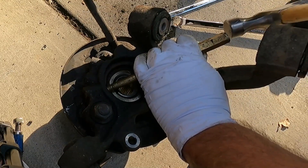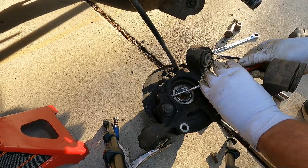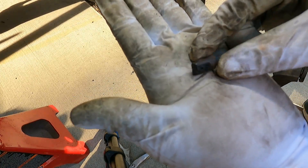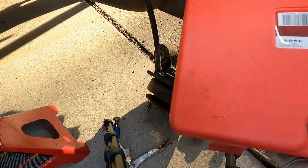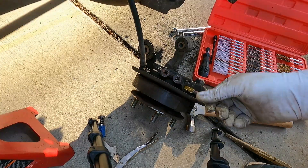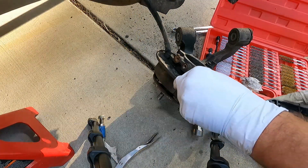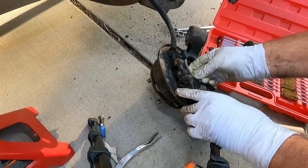I'm just wondering if I can tap it. I went and found this screwdriver that is already bent and it looks like it's going to work perfect — let's see if we can get that the rest of the way out. Got it — that's the rest of the wheel speed sensor right there. Now you can see all the way through. We'll run a brush in there to get it nice and clean. I've got this kit with all kinds of brushes and I'm going to run that in there a few times with the drill.